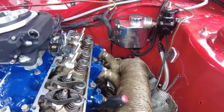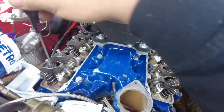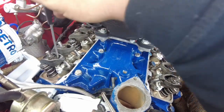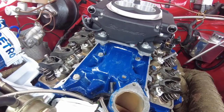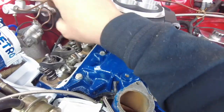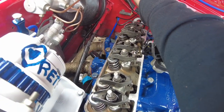Let's get on with cylinder two because that's the next in the firing order. It's dead easy — number one is the furthest cylinder forward and it literally just goes in a zigzag all the way across. So we've done cylinder one, done cylinder four, now on to cylinder two. Stick the screwdriver down the spark plug hole.